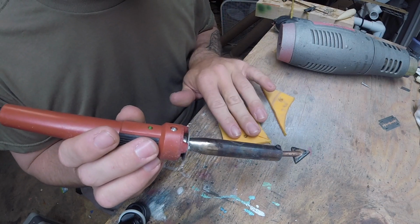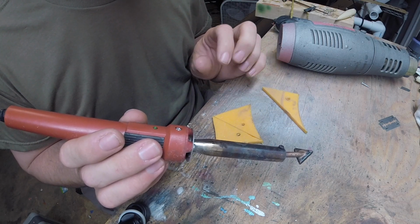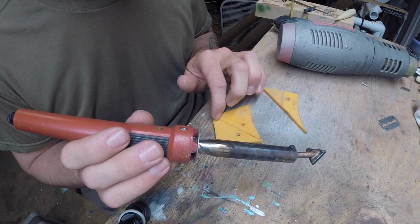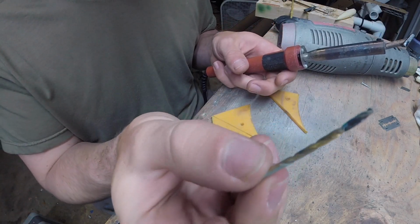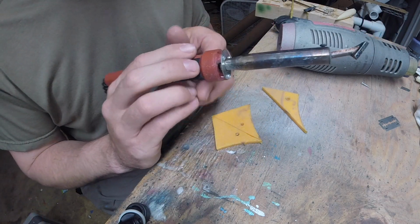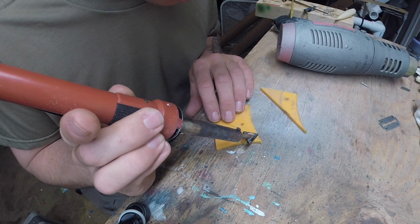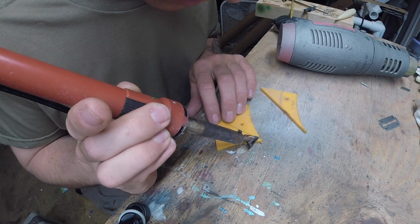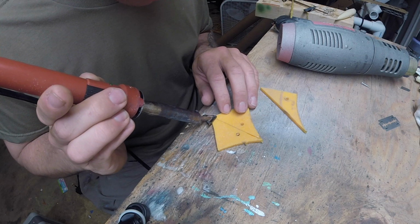Now say you're on your kayak and it's a small crack and you don't want it to split anymore, you'll take a drill bit and on either end of that crack you want to drill this small hole. I mean tiny hole, super small drill bit, guys, on each end. That'll prevent that crack from spreading after this repair. So what we'll do, we'll come in with the soldering iron without anything and we'll kind of just start fusing that gap on the edges where you drilled your holes. Right, just kind of holds it in place for me.